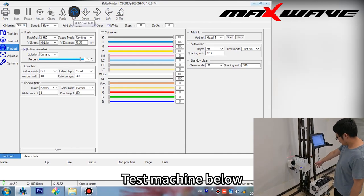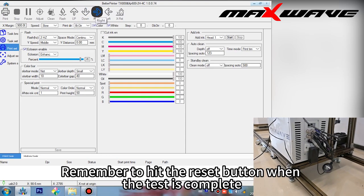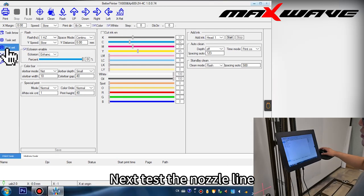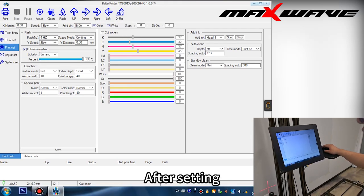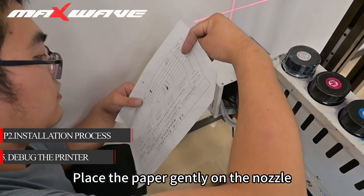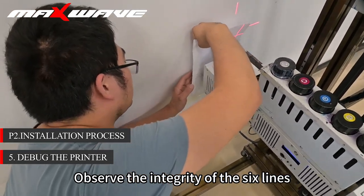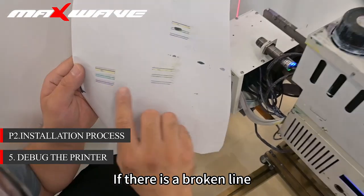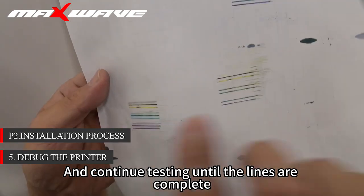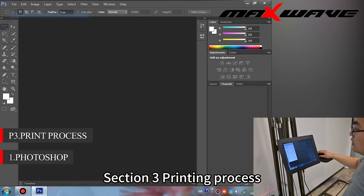Test the machine for any abnormal sounds up and down. Remember to hit the reset button when the test is complete. Next, test the nozzle line. After setting, place the paper gently on the nozzle and observe the integrity of the six lines. If there is a broken line, blot a second time and continue testing until the lines are complete.